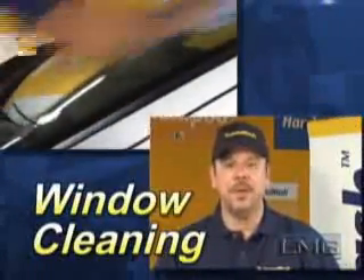The next step in the washing process is the exterior and interior window cleaning process. To clean the windows, use the blue microfiber towel and the Miracle Window Cleaner. Spray a small amount of cleaner onto the surface of the window or mirror and wipe it dry with the blue microfiber cloth. The technician uses the cleaner to retouch the windows to ensure no marks are left on the windows or mirrors. Once finished, the technician will put away all items on the mobile detailing unit. This is the final portion of the exterior wash; therefore, the technician should take one minute to check and verify no details are left undone — details such as marks, unwashed sections, and special note to carefully look on the lower parts, mirrors, and windows.